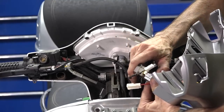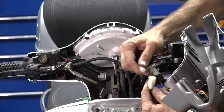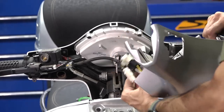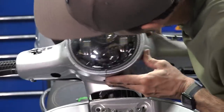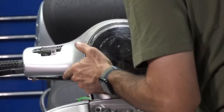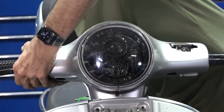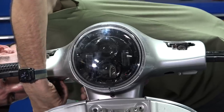The LED headlight has the same kind of connection as the regular halogen bulb — just push that on. This is your running light. On these GTS models the headlight comes on the moment you turn the key on. The older or newer models, the headlight comes on after you start it; with the LED models they're just always on. I tuck the wiring in and get the front horn cover out of the way because it makes installation a lot easier — should have taken that off in the first place. Get it past the master cylinders; there are a couple of little tanks you need to make sure all fit. This old plastic is still in good shape despite being rather old — check the seam all the way down and flex things around as needed.